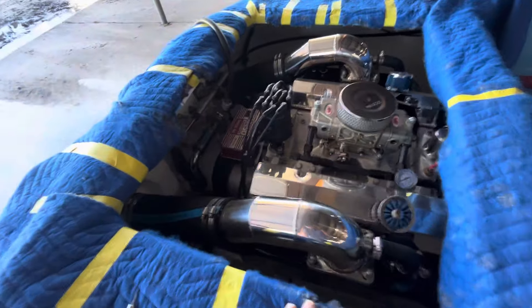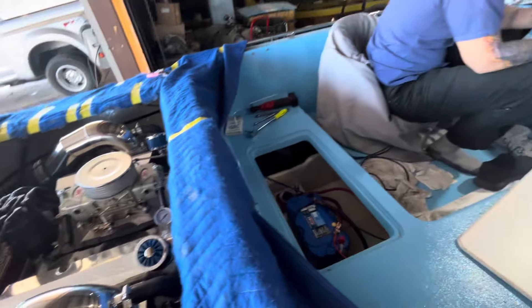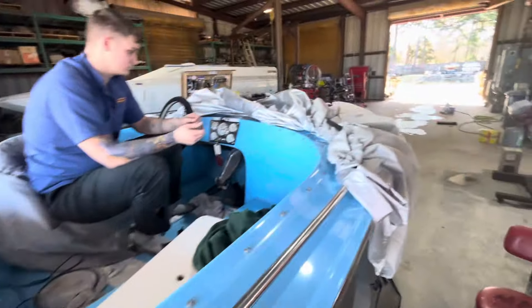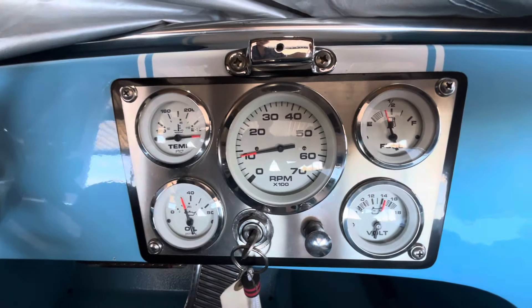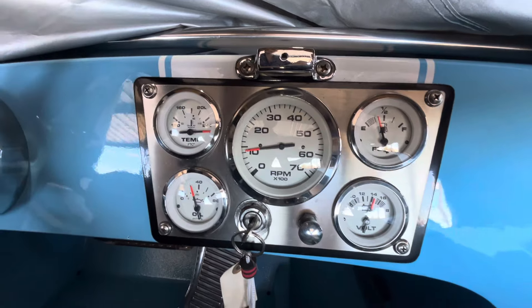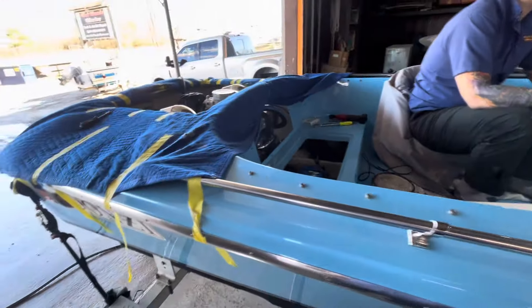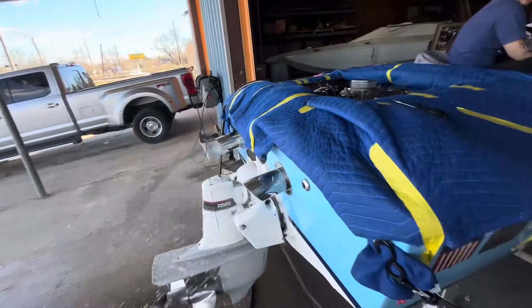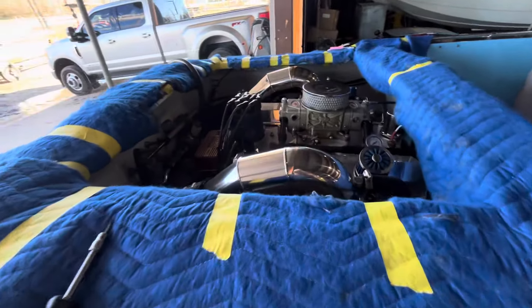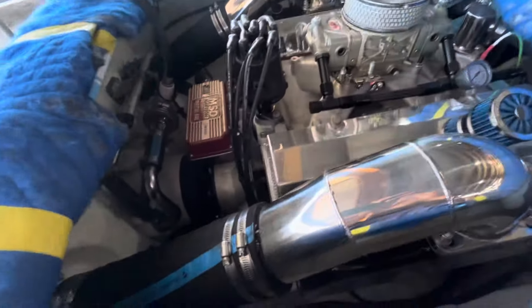Nice and quiet. You can hear the rockers and the pushrods and all that going. We got a tachometer? What are we idling at? We know the oil pressure reading is way wrong — the engine was dynoed and everything checked out fine, we'll get to the bottom of that. Probably just put in an old style General Motors sensor and it'll work fine. Tried to go nice with that VDO stuff and boy, they let me down.